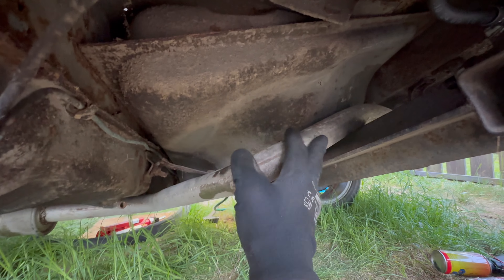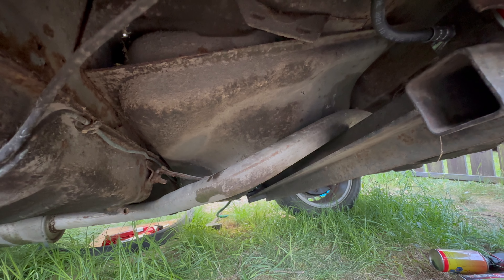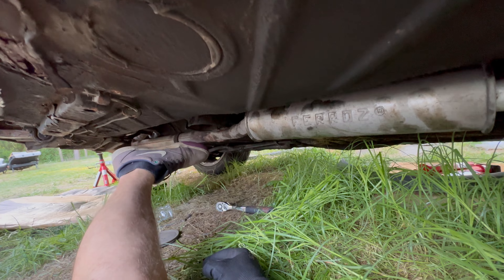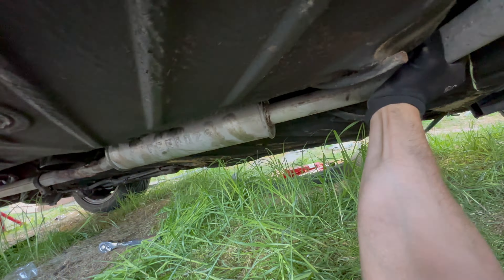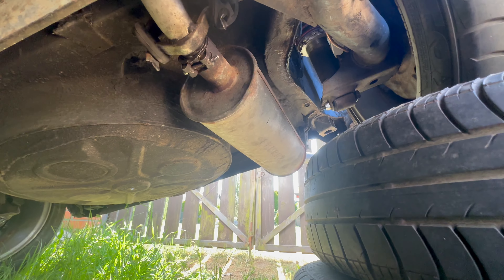This happened — another issue appeared. This part of the exhaust was sitting on the rear beam when it was on the ground, so it would be loud. There's a connection — this middle part connects to the front part right here. I undid one bolt, it's all loose, I have to tilt it. Yeah, it has to be like that exactly. See the clearance now? And I have to do the same thing with the rear end which is here — it was super hard to get out.